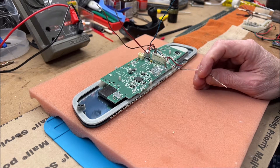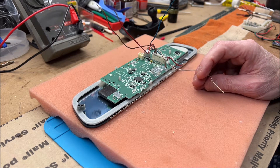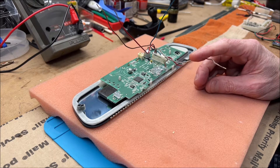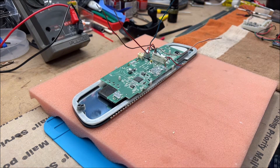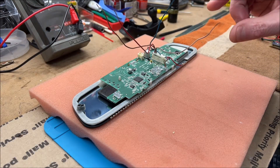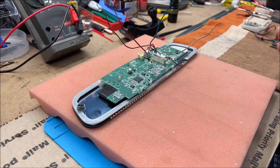The wake-up command is followed by stay-awake commands every few milliseconds, and that keeps the mirror turned on. Any other commands — like locking out auto dimming because the car is in reverse — would also come through the LIN bus wire, but for this demonstration we're not dealing with that. We're just going to focus on getting this mirror to work with the wake-up and stay-awake commands.